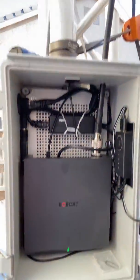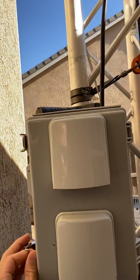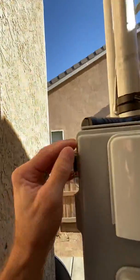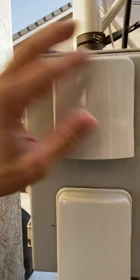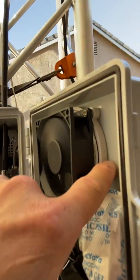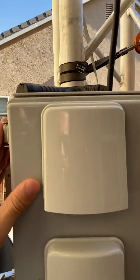All these parts and everything you see here will be available on our blog and in this video. It is really simple — the hardest part you need to do is just drill a couple holes in the case. These right here are their own individual vents. I just drew out a hole, lined it up, cut it out with a scroll saw, and was able to pop these in. The coolest part is these little rings right here — these rings screw onto the back of these vents securing them, and they have the complete correct bolt pattern for standard 80mm fans. You can screw the 80mm fans to these locking rings to secure them to the case, and they have a rubber O-ring to make sure no moisture gets in through that area.